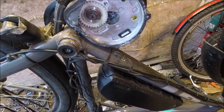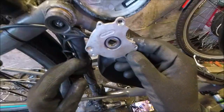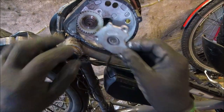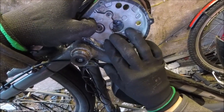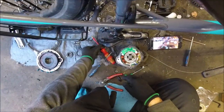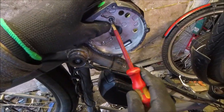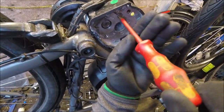Put a bit of grease on it. Put this cover back on — it's the cover that goes on here. Put the bearing on the outside, then put this cover back on. There are a few countersunk screws that hold it on. It's important to get a screwdriver the exact size so that you don't chew up the head, because these need to sit flush.